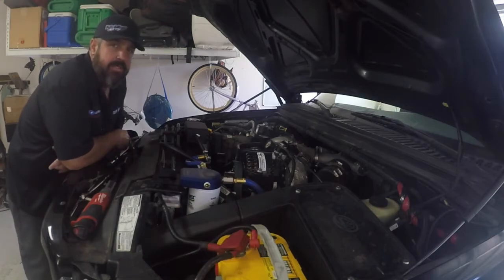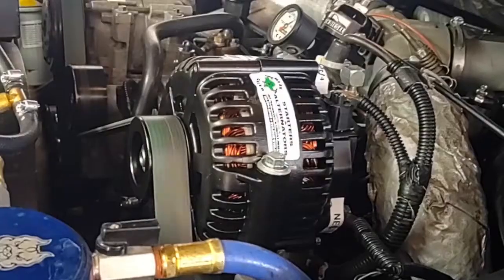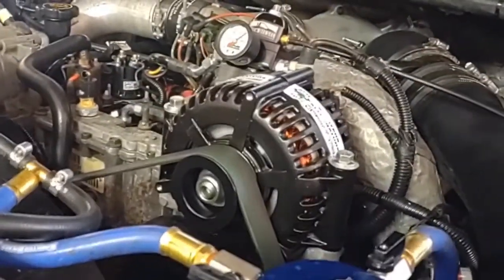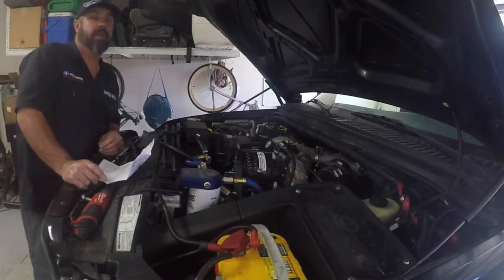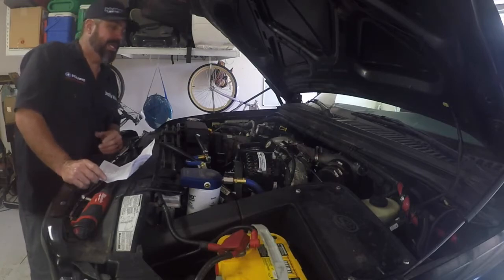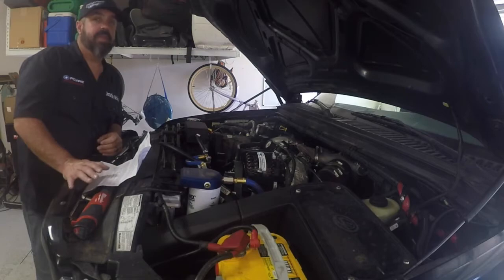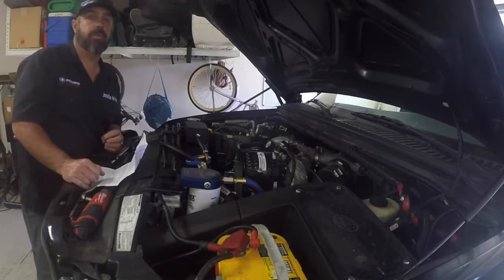Our Mean Green alternator is now installed. Just go over and check all your bolts — your 13mm mounting bolts, the 13mm nut for the power cable on the back of the alternator. Check and make sure that the plug is completely plugged in and snapped in. Tighten the bolt on the back of the ground cable for the alternator, then go ahead and put your battery terminals back on your batteries and fire up. If the belt squeals, you might need a slightly shorter belt — the instructions say that and they come pretty detailed on how to do the job. You just need to be able to unbolt bolts, put it in, make sure the alignment's good, tighten up your bolts, plug in your wiring. The only thing the kit did not come with was the ground cable, and we just made one — simple, go to your hardware store or auto parts store and pick up a cable.